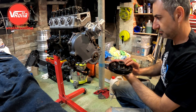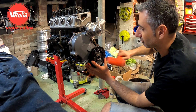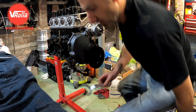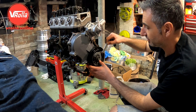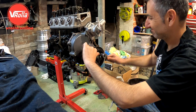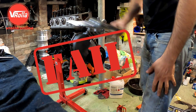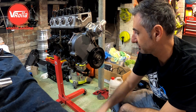I'm going to put this pulley back on. I've made a tool - hopefully that's going to hold it. It's only out of aluminium, to hold the crank as I torque it up. Fail - alright, that tool I made was useless because it just bent out of the soft aluminium. I'm gonna do a bit more research on how to tighten this up without the right tool, or I'll have to get the right tool.